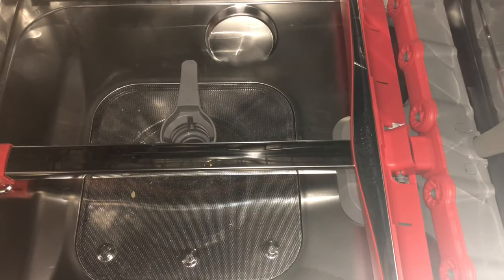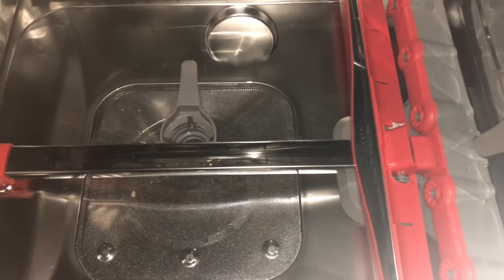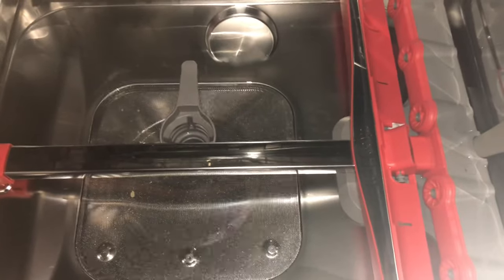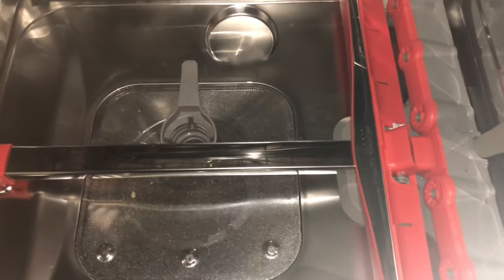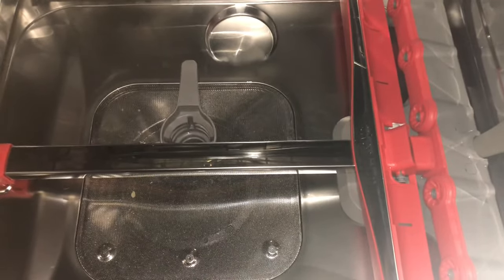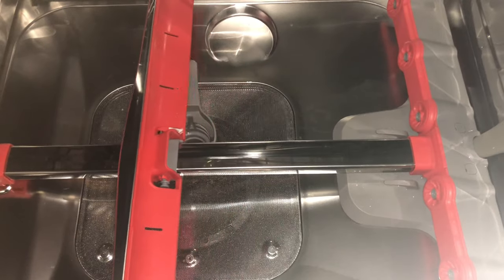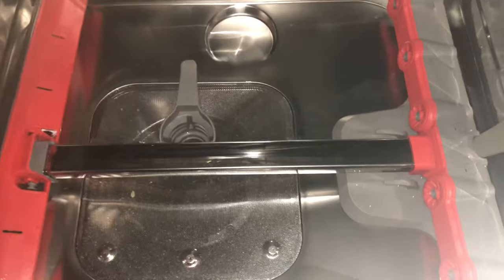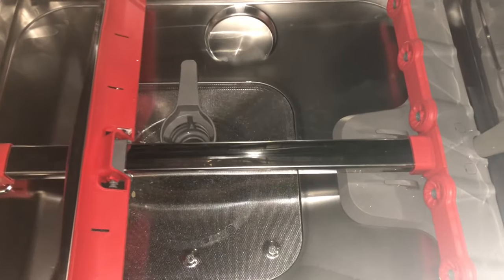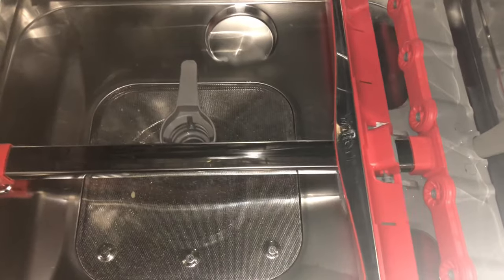There was a bit of a technical error so I'm going to have to voice over this part. What you're hearing in the background — that's pretty loud — is the drain pump. What's going to happen here is it's going to send the bar all the way to the front, and then it's going to try to track back and pick up a home position. Obviously the magnet doesn't work, so the sensor contact is not being made. It's going to keep doing this. Most of the time it does it two to three times before it will start the cycle — it's kind of a flaw with this machine that it will start the cycle even where this doesn't function, and then you open it up and the bottom half of your dishes are still dirty.